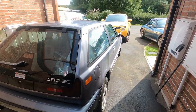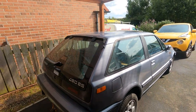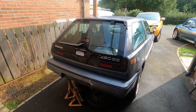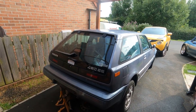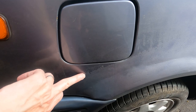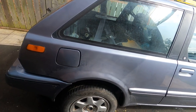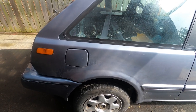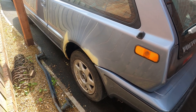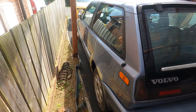First things — it's been sat here an awful long time. The paintwork is not doing so good because it's getting a lot of dust and dirt on it. I have given it a little bit of a spray wash and a clean, but it's still not great. It is going to need a fair bit of detailing — machine polishing, that kind of thing — and then a new wax finish. Also, where I've repaired the wing here I didn't put a clear coat on, and you can see what's happened. That's going to need sanding back and blending back in again with the colour paint. Around on the other wing I didn't actually finish painting it, and you can see a little bit of rust starting to creep back through. It's by no means a permanent job, which is a bit disappointing.